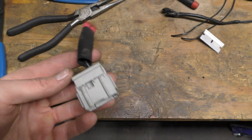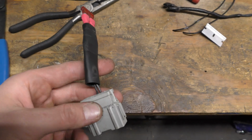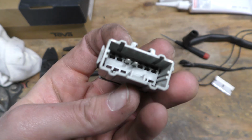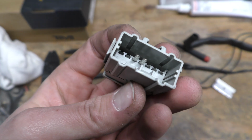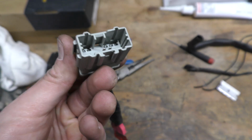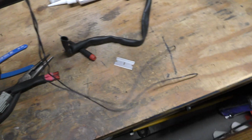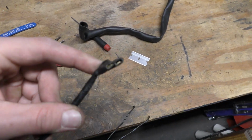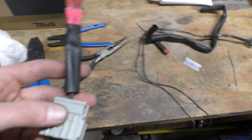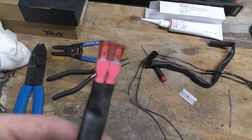use a fuse. I just took the plug off of the hand controls, and then you just pull out the pins. So all you're left with is just the two wires that go to the clutch switch pins off the harness. So when you plug this in, you're just jumping those two wires. So this is what you have off the hand controls. There's just two spade connectors, and prior I just put the fuse in here and had this huge long thing. So I just crimped some of my own spade connectors on there.